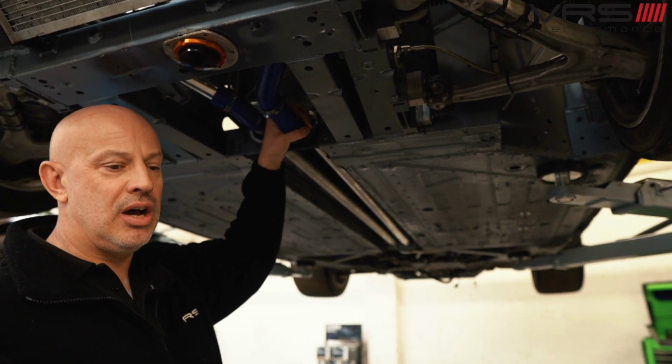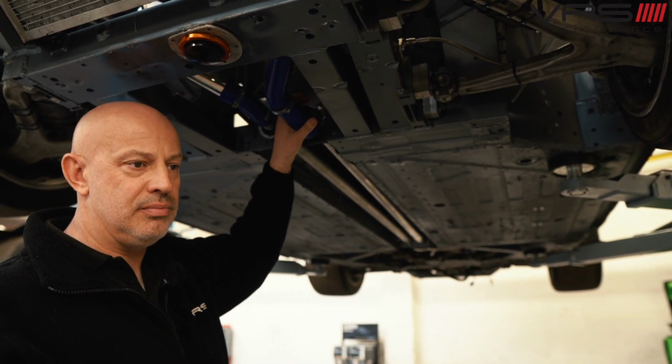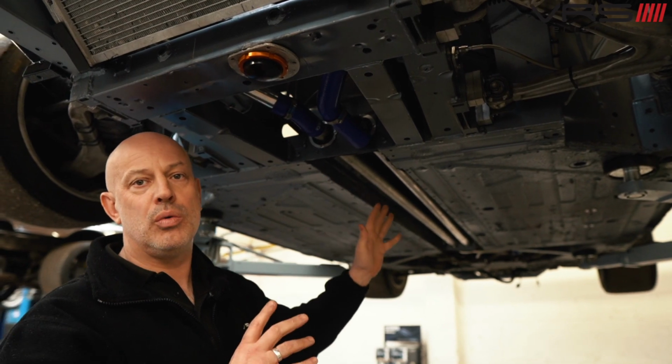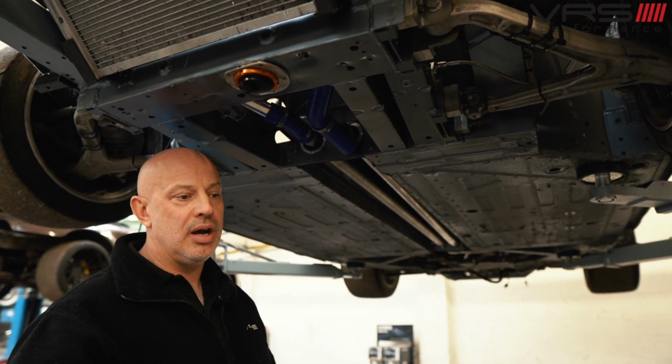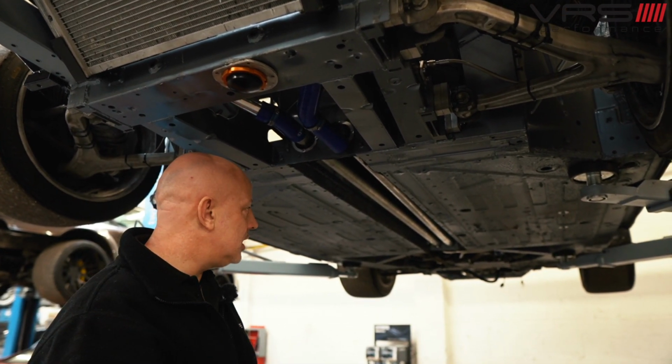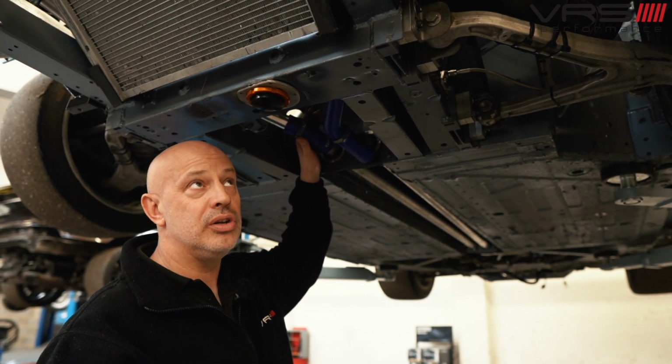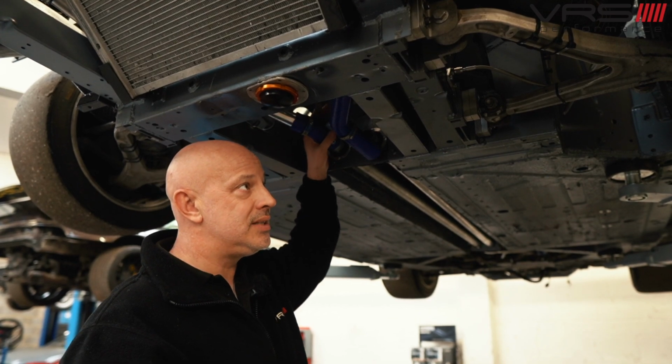Basically what's happened is the car's been purchased, I think, and it's had a standard engine put in, and a standard wiring loom. So we've then rewired the car for what's here. It's got a PDM in the car, so there's no fuses or relays. It's all done electronically. That's all been rewired. All the brake lines have been done, the clutch lines, they've all been replaced.